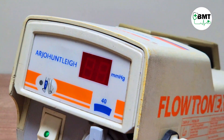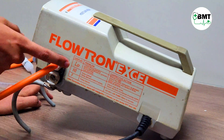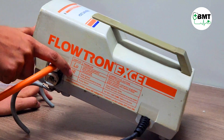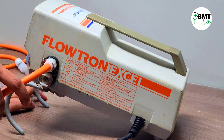If the F error appears, there are two possible causes: the tube is not connected properly, or there is a power failure. These are the rest of the error codes, along with the corrective actions you can follow. LO means there is an internal leakage or leakage in the tube.